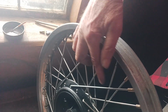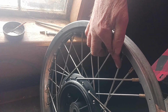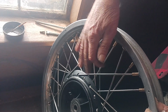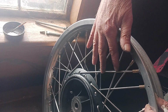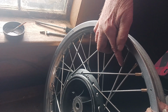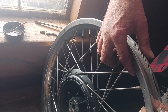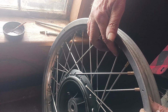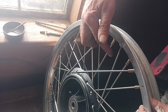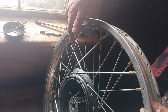these spokes here, all of them were very crooked, and these weren't too crooked, but these being extra crooked before, because the hole was in the wrong spot, it made it bend worse and moved the wheel so that these stayed straighter. So these holes I filed out quite sufficiently, and these ones I filed out a little bit, but I didn't file out enough, because now that this spoke is straight, it put the strain on this one, so all these inward ones ended up, I should have filed a little bit more.